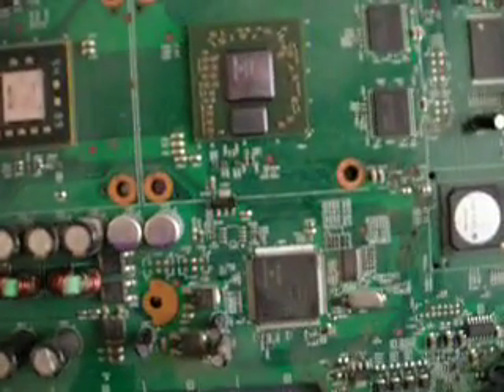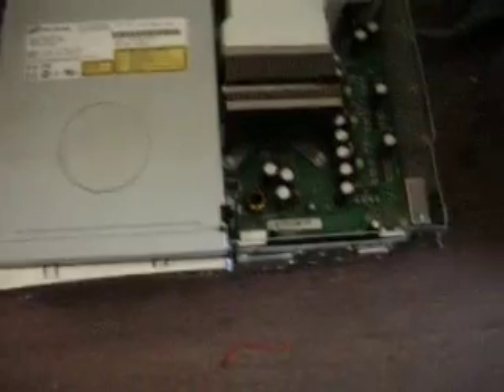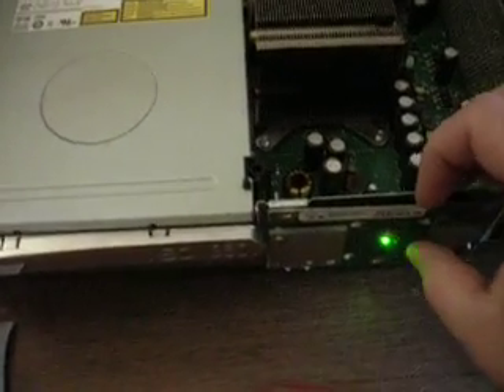And there you have it — none of the caps are bulging. Just let it sit for 30 minutes or so until it's cool, then come back and reapply your X-clamps and you should be good to go. I've got my Xbox here — 0102 — back in the metal chassis, DVD drive and everything back on. The X-clamps have been replaced with M5 screws. Basically what you need to do now is turn it on and hope for the best.